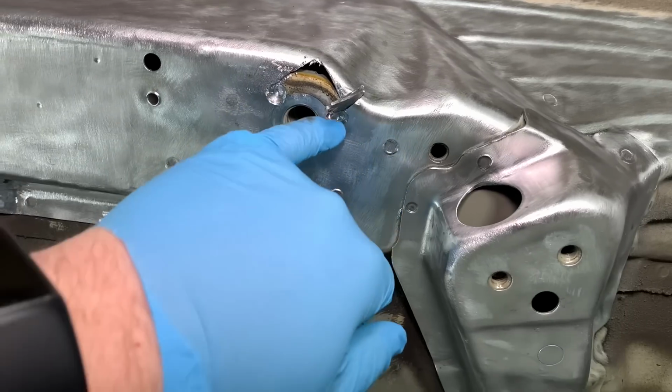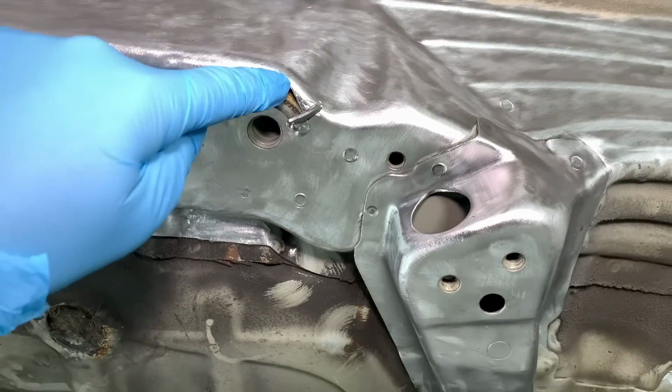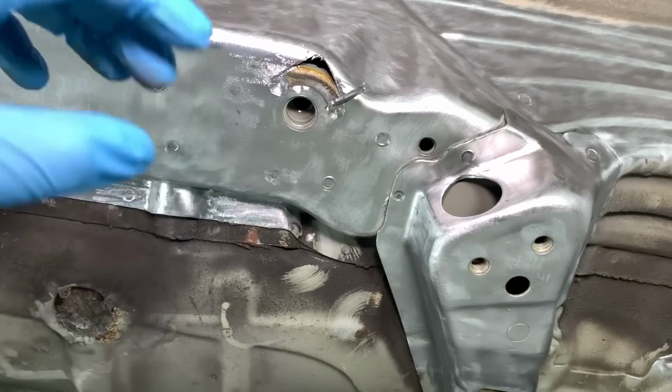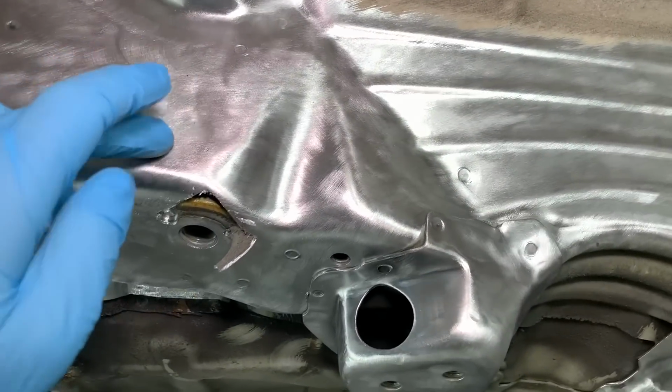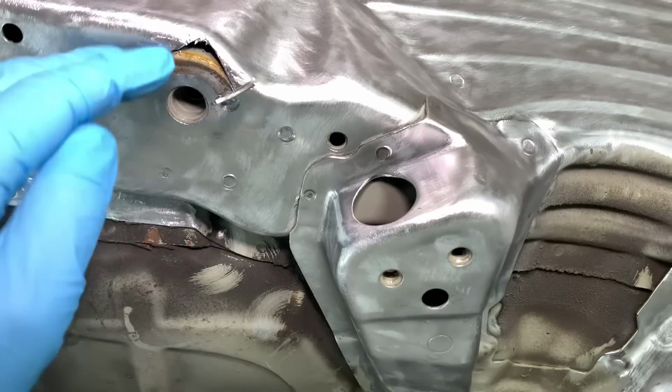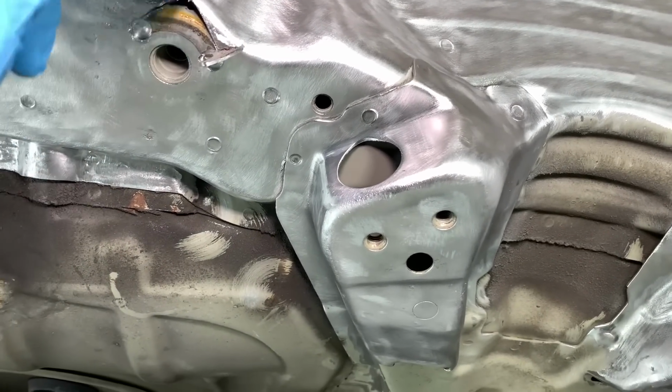So we do, at the end of where we believe the cracks are, we do a stop drill. 8mm we can do on the underside because there's a platform behind it, so that allows us to do a nice penetrating plug weld into that piece. Up on the vertical section there's nothing behind it, so you can only do 2mm up there, but 8mm underneath, and then we do a sort of another middle one, and then do 2 lines which then join.